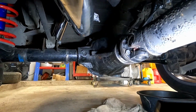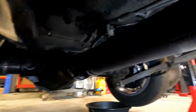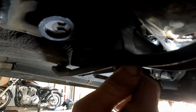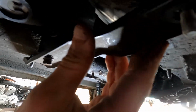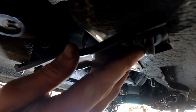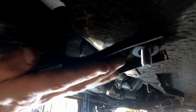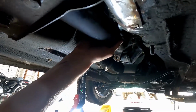Alright, so those are down and torqued. Those are 25 foot-pounds. So we're going to move on next as we scoot up along our handbrake, if I don't blind myself, right up here with our carrier bearing. You can see it lined up perfect with the studs and our nice new grommets. So we're going to grab our nice big flat washers and our nice new nut, and probably throw in a lock nut too, just to be safe on both sides, and get this up to the body. It's looking good. We're getting there.